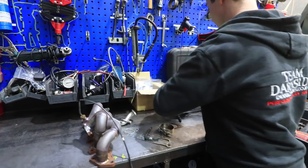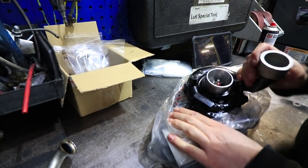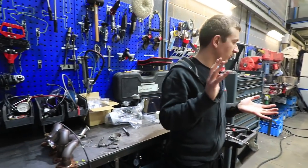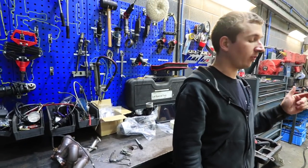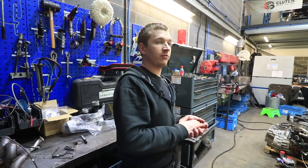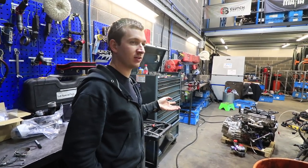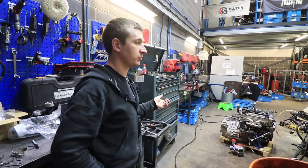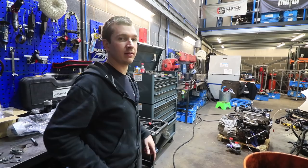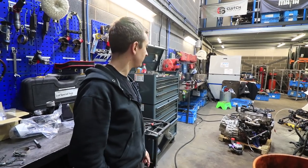And then the 28 turbo, easier just to rip it than it is to do that. So ball bearing 28 is going on. So hopefully we've got to split that gearbox apart, put the diff in, stop that falling, that radiator behind you. Split the gearbox apart, throw the diff in, which has got a Wavetrac going in, because I believe at the time of filming this, the only company that make a diff for them, the DQ500, is Wavetrac. So we'll get that in there, and then Owen's swapping all the bits over to the new engine. Fire them in and away we go. So hopefully it's not too big of a job. It's sort of all hinged upon how much hassle Paul has putting that diff in, but we'll see how they go.